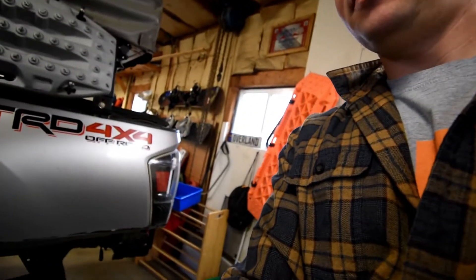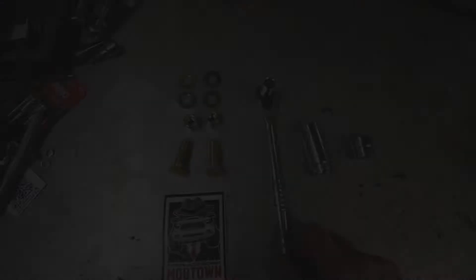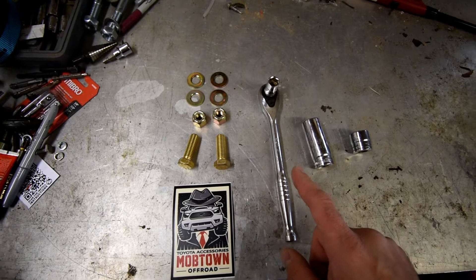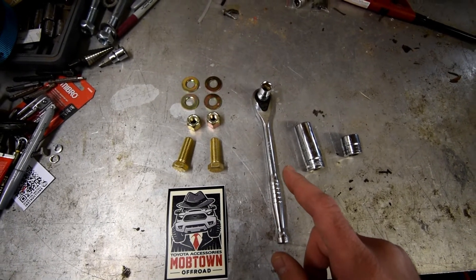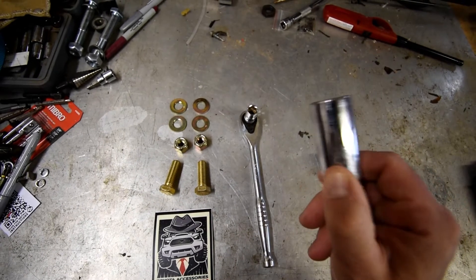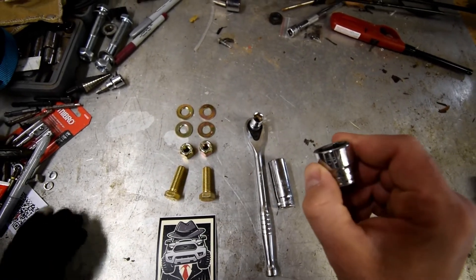It's pretty simple but there's a few things you need to know. First, your truck needs to be empty — no fuel in it. I've only got a couple gallons in it. This is because they're using the factory gas tank strap nuts to hold some of the skid plate on. The truck's empty and I'm still missing my bumper — it's out at the powder coater for a repaint — so I've got some extra room under there to get to all the bolts.